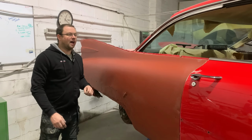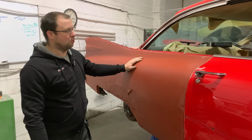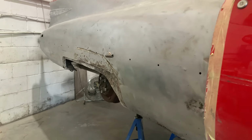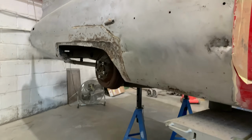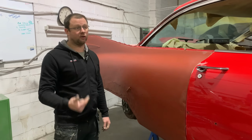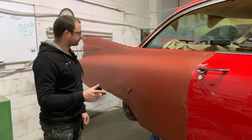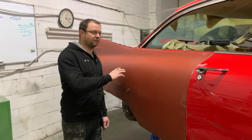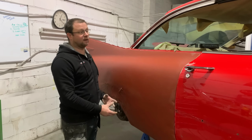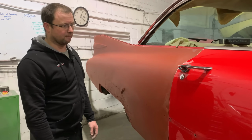Good. Right, as you've just seen, Bo's been really busy getting all the paint off, so we'll do some overlay, lovely bare metal wing, if you ignore that bit which isn't so lovely. Once it's all stripped back and it's bare metal, we put it into the Novol Classic Car Bodywork primer. It's a holding primer, it's non-hygroscopic, it's not epoxy based, it's water resin based. And that protects this whole panel from oxidizing. We can weld through this, so it's a weld through primer as well. It's a really great holding property, really awesome product, as always, from Novol.